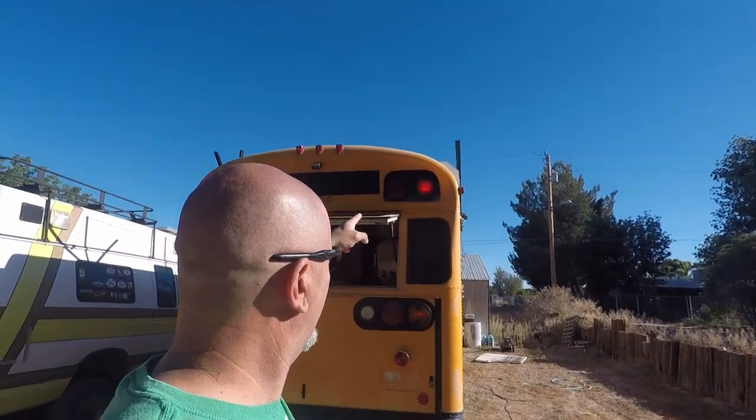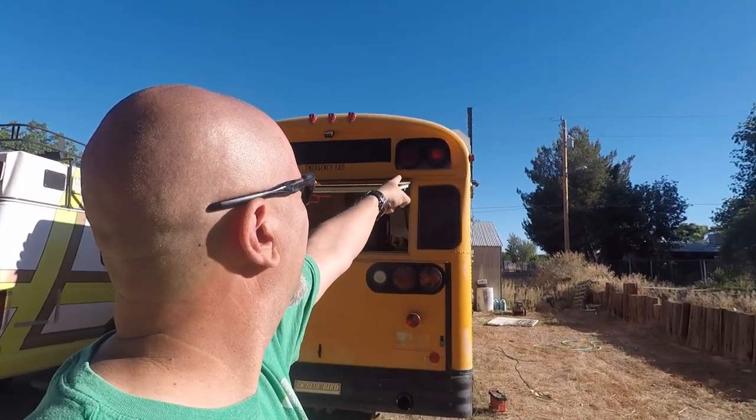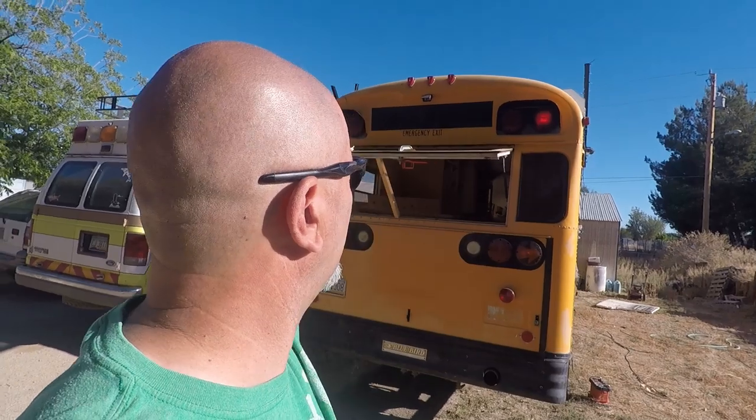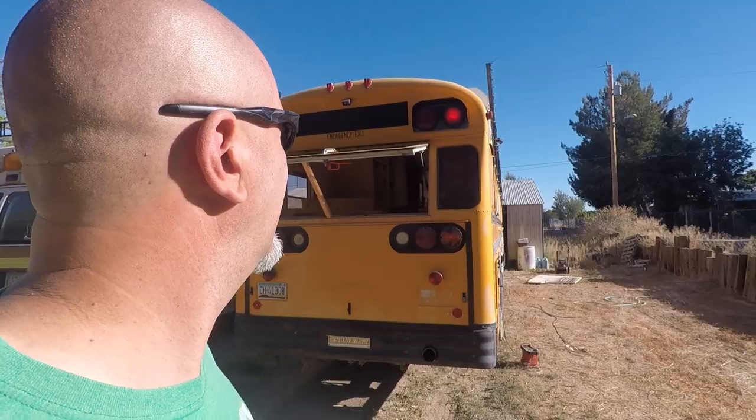I wanted to share something with you guys, something I wanted to do since I got the bus, and we had talked about it right from the early beginnings, and that was to repurpose those lights up there. I just didn't want to waste those lights in the back. We decided to keep the ones in the back. But they couldn't be emergency lights anymore. They actually had to be something. And so I tied them in to the turn signal. I'm going to get orange ones for up there. But you can see the turn signal working with that one. And it works on the other side too. And I've also made the brake lights work on the inside ones. But I have to have the engine running to do that, and I just don't have it running because then you wouldn't be able to hear me. But brake lights work and the turn signal. So it's kind of cool. Just a little something I wanted to get done. And we did.